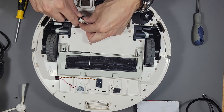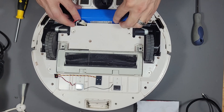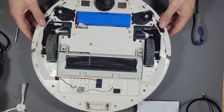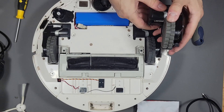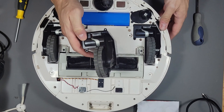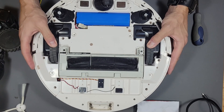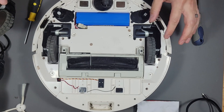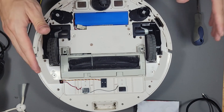Almost forgot to put the battery in — I did replace the battery, so this should last a pretty long time. Now feel about the same resistance on this one. This old one — look at that, you can barely move it. A good troubleshooting step is to grab it on both sides, roll your thumb forward, and feel if both wheels have the same resistance. If one is harder to push, that motor is likely bad.